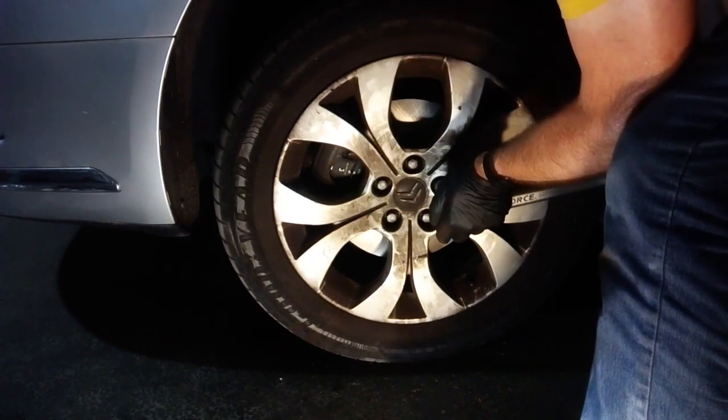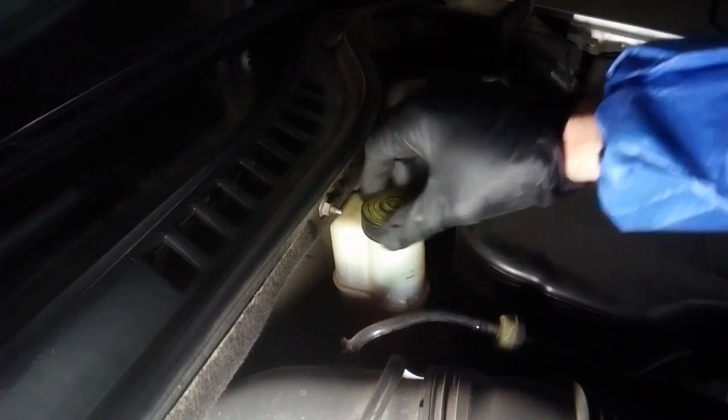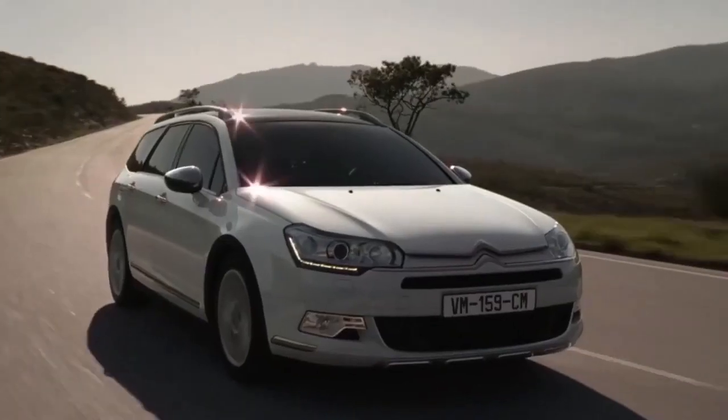Before starting the car, it is not a bad idea to push the brake pedal either by hand or with your foot so that the new pad comes in contact with the rotor. This way you won't be surprised when you step on the brake pedal for the first time with the new elements. You might also want to check the brake fluid level one last time. And that's it — job done. Time for a road test. Start the car, lower the suspension to the normal position and off we go.